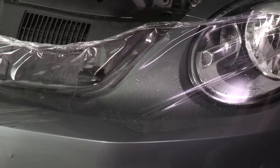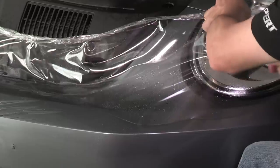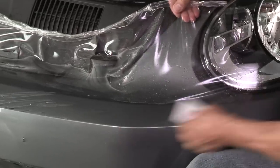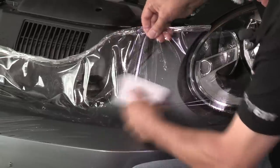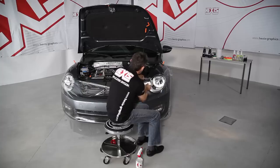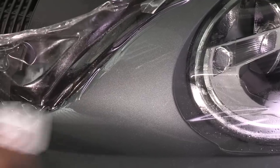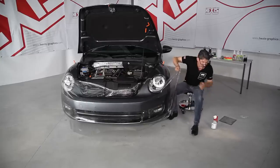We're going to moisten the area a little and apply to the concave area. To do this, we're going round the headlight to take tension off the product. Always apply in the same direction so as to keep the evacuation well under control. The concave area is now applied. We lift the product, moisten behind, and stretch again.